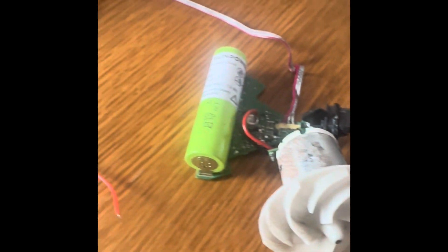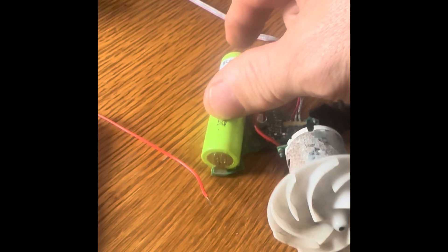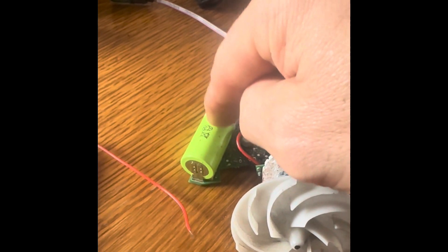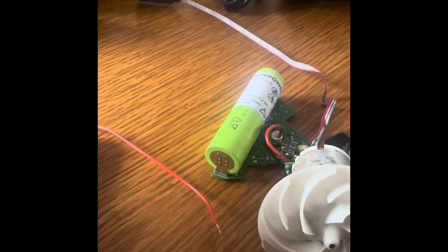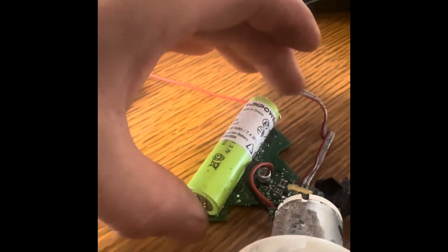We've done it — the indicator light is now flashing and this is plugged in! What's happened is that as these batteries get older they can discharge, and if you leave them for a long time they can discharge way below three volts. This battery was at 1.4 volts — way too low. The system just won't even think to try recharging it at that point. So you need to increase the voltage by connecting a good battery in parallel, positive to positive and negative to negative. Because the good battery has four volts, between the two of them it jumps the voltage up, and while they're connected like that you plug the charger in — the light is starting to go green.